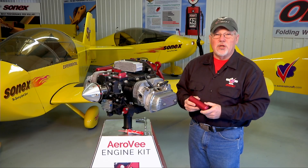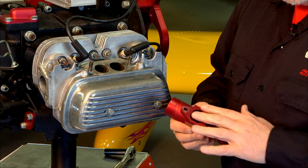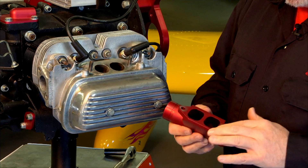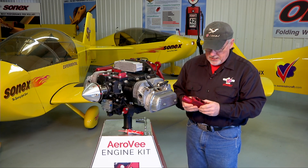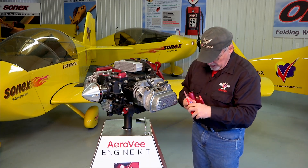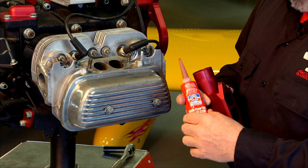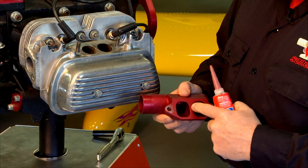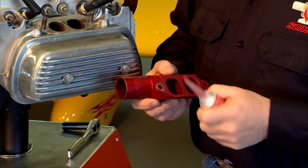In this segment we're going to install the intake elbows on our heads. We don't use a gasket on our intake elbows. In the automotive side you'll read a Volkswagen manual and they'll have a little metal gasket that goes between the head and the intake manifold. With our proprietary intake elbows we don't use a gasket — we just use some sealer. What we use typically is the high temp RTV red sealer and we make our own gasket with the sealer, running a bead around each of the intake ports and then attaching the elbow to the head using that sealer as our gasket.